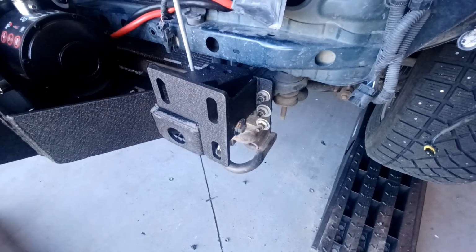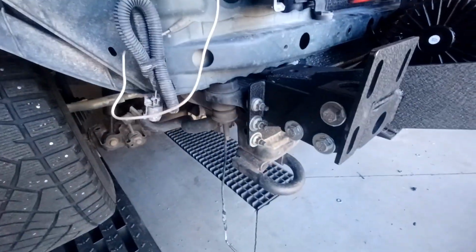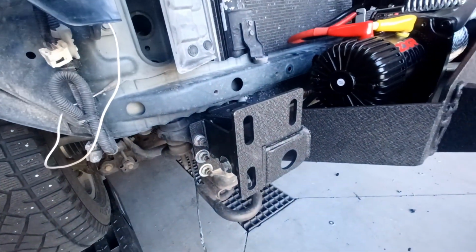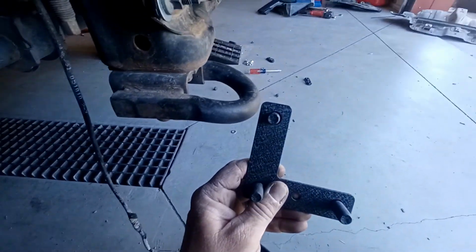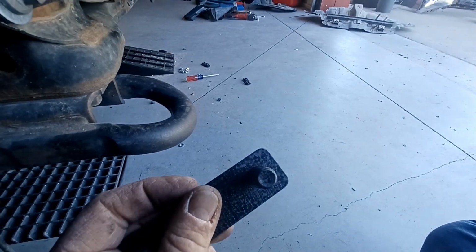We have now installed the winch plate and used the factory 4 bolts on either side. Everything's cleared. We mounted these brackets earlier. They are now going to accept the bumper that my partner and I are going to install. This L-shaped bracket fits up and behind the bumper and supplies the bolts for mounting your bumper. You have to work it in there a little bit, but once it's in there, screw your washers and lock washer on and crank them down and your bumper's on.